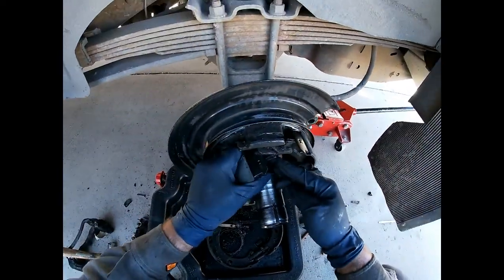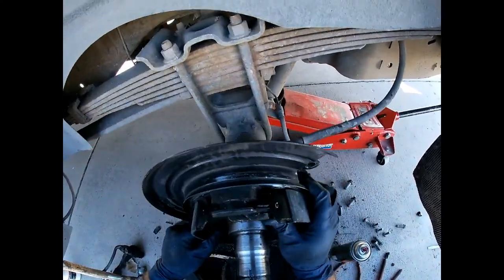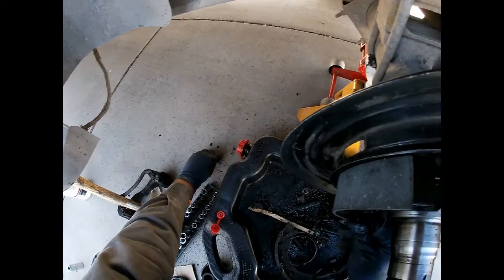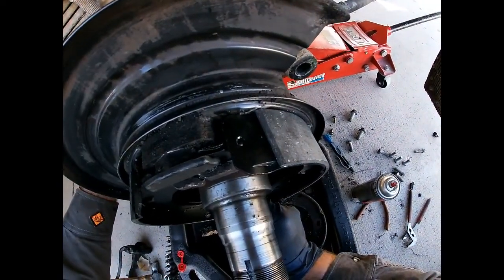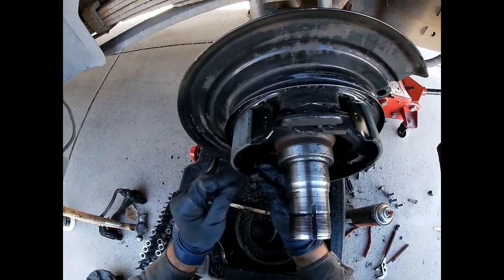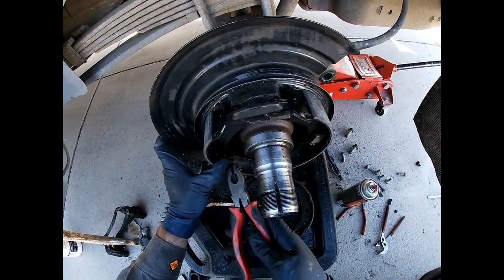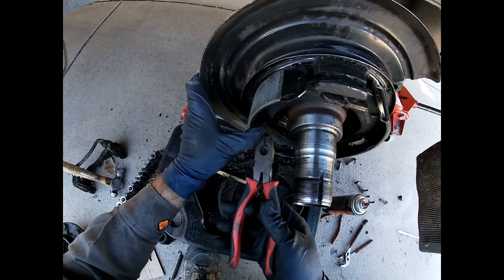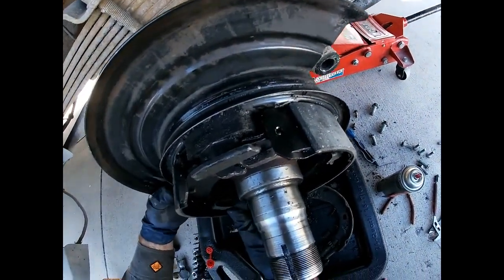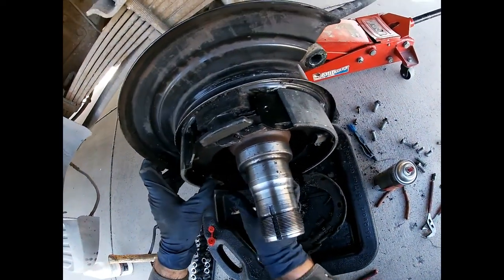The back spring is hooked on both sides, so I need to stretch it over there, push that one in like that. Now the bottom one needs to be addressed — you take this little pin, shove it through, then take the front portion, use pliers, push on it, and what we're trying to do is get this pin to go through there, and once it's through we'll twist it. That'll keep the brake shoe in place.